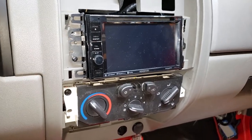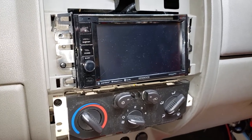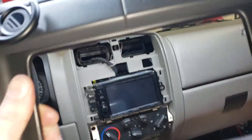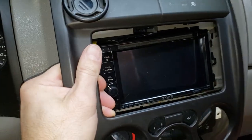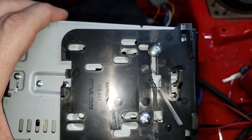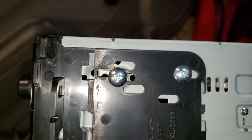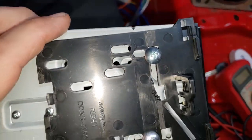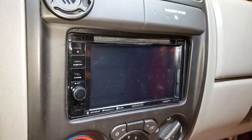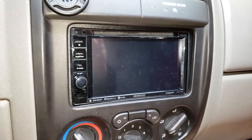What I'm doing right now is test fitting. Before I hook anything up, I make sure that it fits in the dash. If I were to put this in now, I'm off by a little bit, so I have to make some adjustments. The way you make those adjustments is by using all those little holes — all those options. I'm at a pretty good angle on this part, but on the other side I'm flush. So I've got to loosen those screws and move this around to where it lines up better and try again. Four was the magic number — just plan to have a lot of patience when you do this part because it's going to take some wiggling and jiggling, but it'll get there.